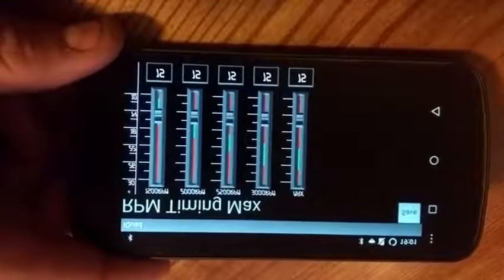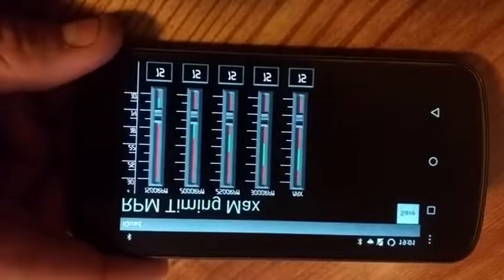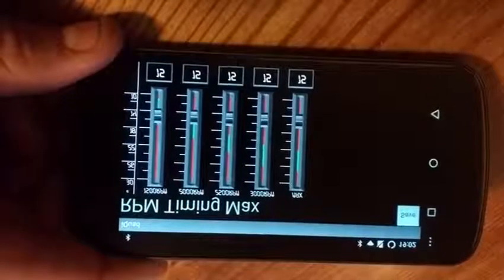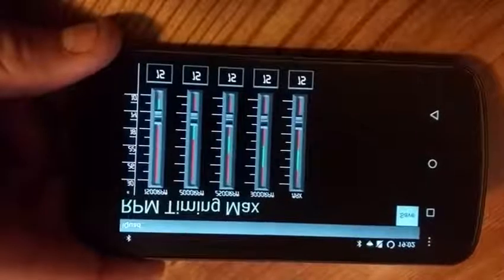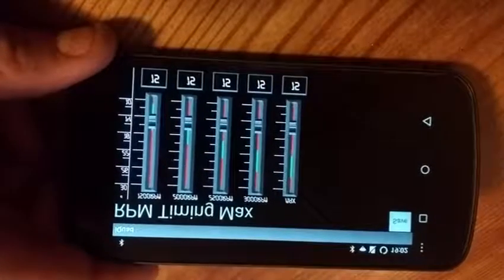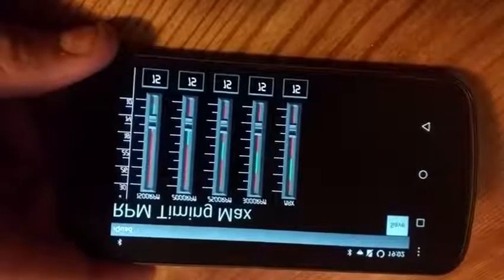At about 1500 RPM, our OEM truck likes to keep it somewhere around 11 to 12 degrees until I'd say 2400 if you're on the throttle. Once you hit about 2400 RPM, that's when timing starts to come off the bottom and increase up to about 25, 26 degrees of timing max.